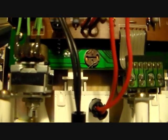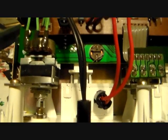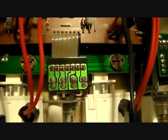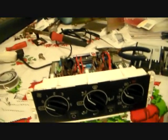So I took a look, and sure enough, down in the back on the circuit board, that's the illumination for that button. That's not the orange thing I told you about, that's this. Six lights in this thing, can you believe that? And then there's the one for the right side, that's the air conditioner button, which is working. So I had to take that thing out and wrap another bulb into it. See my neat job there. I used another one of my Radio Shack bulbs and put it all back together, and it seems to work now. I went outside and tested it.